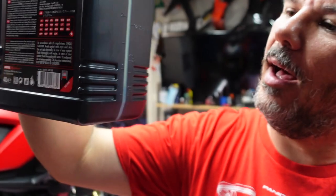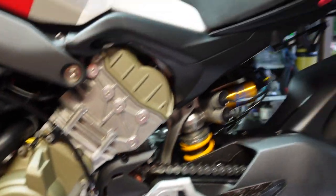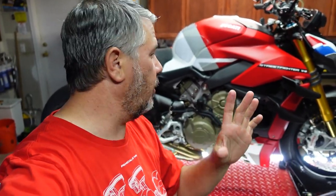Rinse and repeat — fill it up a little, turn it on, let it run a little bit. Almost every time I've filled this thing it comes out almost perfect. You can see we're right at the top mark. Tomorrow we'll check it in the morning and it should be about the same, though it might read a little higher. My understanding with the Panigales is you want to check the oil in the morning when it's been sitting on a center stand — that's when you're supposed to check it.